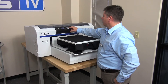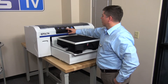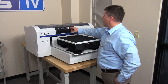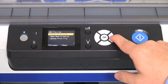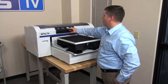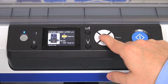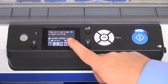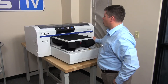Press the menu button to get to the menu selection and select USB file list. Press the right arrow to proceed. Select print file, press right arrow to proceed. Hit OK to execute. Verify this is the shirt you want, then hit OK to print. When the shirt is verified that it is in position and you're pleased, press the print button.